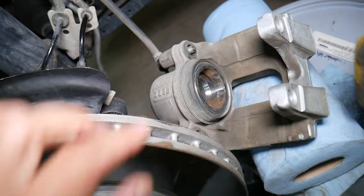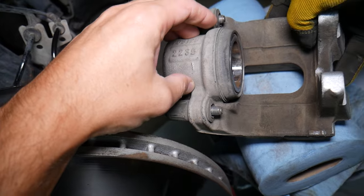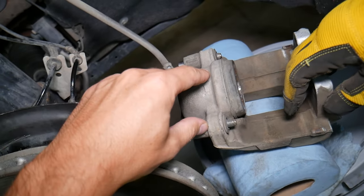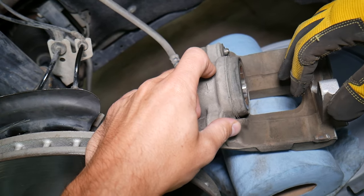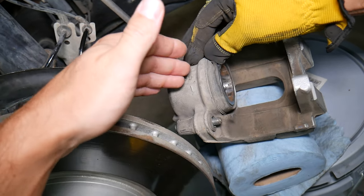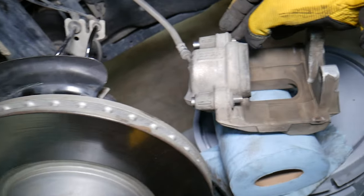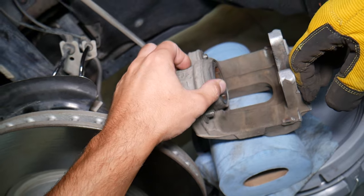There is a special procedure where you flush the brakes, and that build-up may end up in the piston here, building around the piston and the caliper itself. That can cause the caliper to lock up. Another thing that can easily cause lock-up will be not driving your car for a long time. When you let it sit, you can experience that mostly with sportier BMWs — people that drive them mostly in the summertime, but park them in wintertime and drive their SUVs instead. In my experience, locked-up brake calipers happen because when you let them sit, things sometimes get stuck.